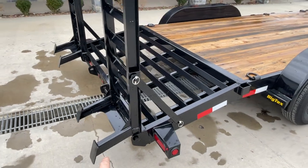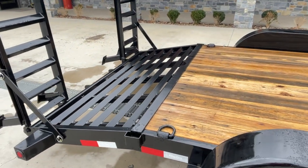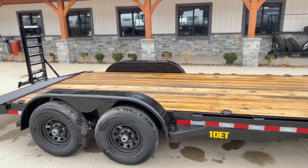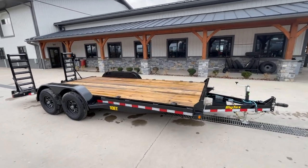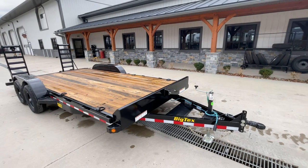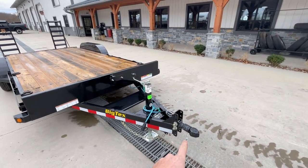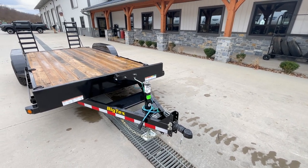You've got your kicker knees or knee ramp supports at the back. LED lights. This trailer, I don't think I mentioned, is going to weigh in about 2,500 pounds. It's going to give you a net legal payload on the trailer side of about 7,500 pounds. That doesn't count your tongue weight — tongue weight to the jack and your coupler is going to be about another 15%.